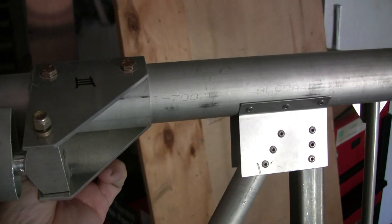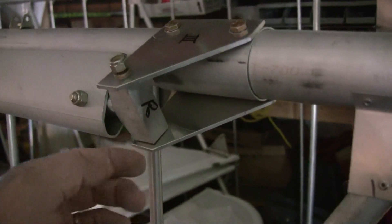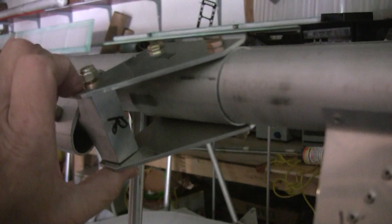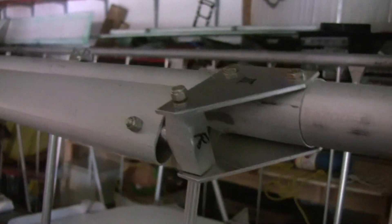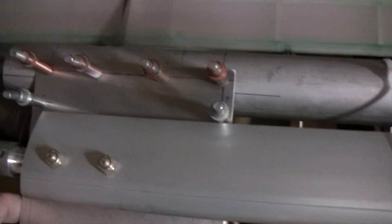The nut is on the opposite side, and this is how your lift strut brackets fit in here. I do not have this nut tightened down simply because I don't have the wings on yet. I did that just to hold it in place and to pre-fit these. The other end of this I have tie-wrapped to the spar until I get the wings on the fuselage and start doing trial fitting.